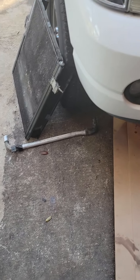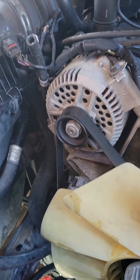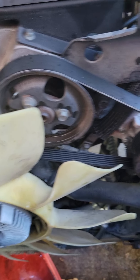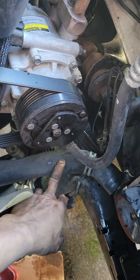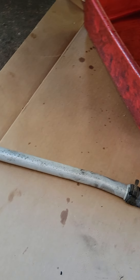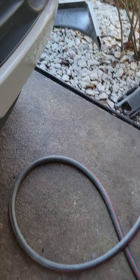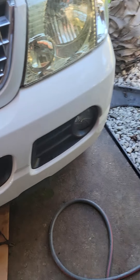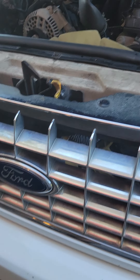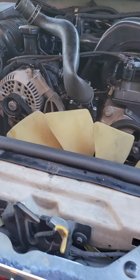I hope this will help you. If you want to see other videos of how to take it out, you can search for it. You've got the bottom coolant hose and the top one right up here, and then this bottom hose right here — just disconnect it and take it off. Of course you've got a couple of plastic shrouds, and the fan shroud comes off in two pieces, so that's easy to take off. I got it out finally — cut myself doing it — but I hope this will help before you start your project. Thanks a lot and have a good day.